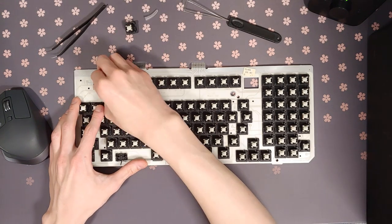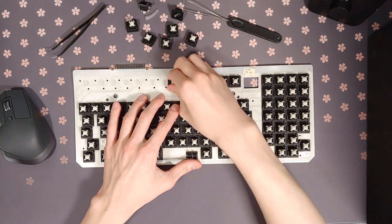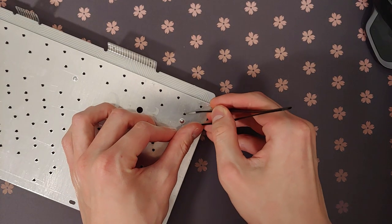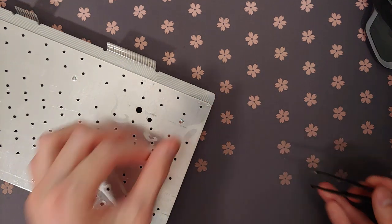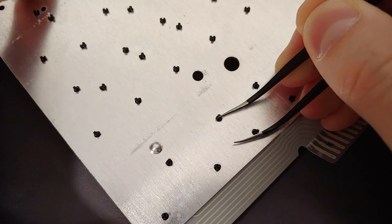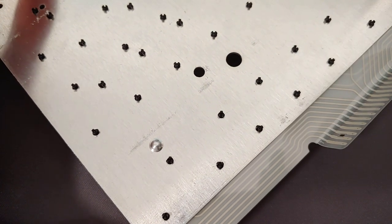Before we get to the modding, you'll have to remove the switches. I recommend doing one area at a time, since you really don't want to misalign the membrane sheets and impact the functionality of the keyboard. To remove the switch, start from the bottom of the assembly. The switches are mounted onto the plate with clips with pegs through them. The concept is similar to Intel stock coolers and GMK keycap tray fasteners. Pushing the pegs in will loosen the clips, and you should be able to just pop them out. I did one row at a time.